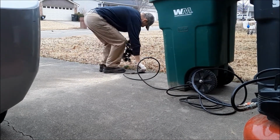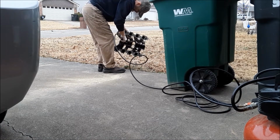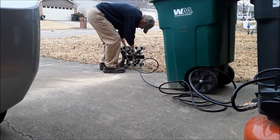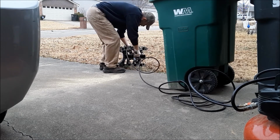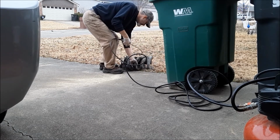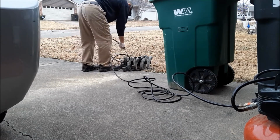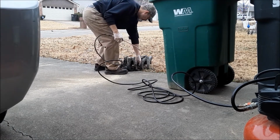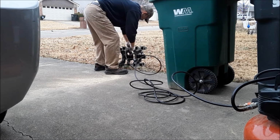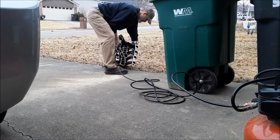And now that I've got that all torn down there, I'm just taking this out, blowing it out with some compressed air, and don't be a dummy like me. Go ahead and put some safety glasses on anytime you work around compressed air. Blowing down inside the individual runners. Try to blow some of that insulation out that fell down in there.